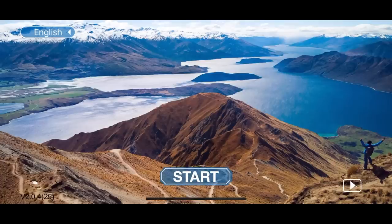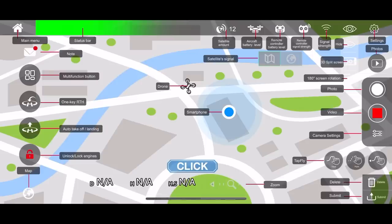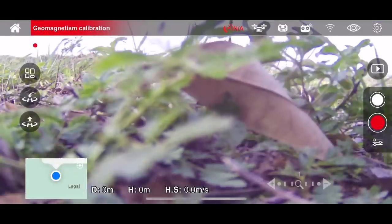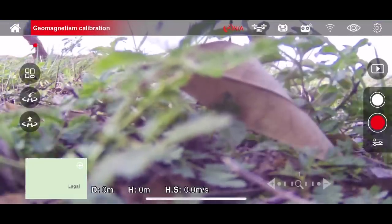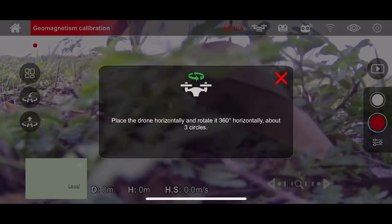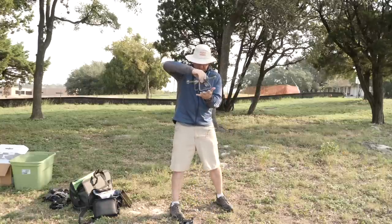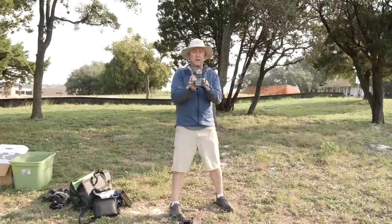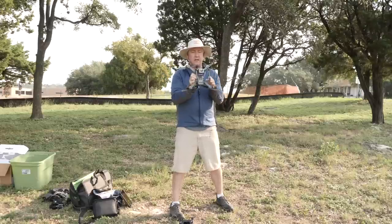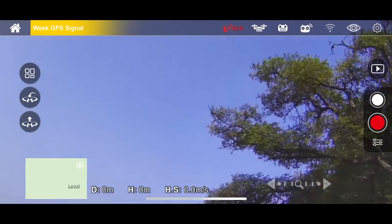It's connected via Wi-Fi. I'm going to hit start and next on the app, and it's going to show me how many satellites I have — currently 12. You hit the click button, and it says geomagnetism calibration. To calibrate the compass, you hit this little envelope in the top left — that's where your messages are, and it's telling you to calibrate the compass. So I'm going to set it down, pick it up, give it a spin until it feels good, then turn it upward and give it another spin. Compass should be good now.